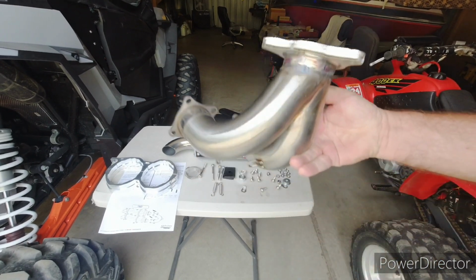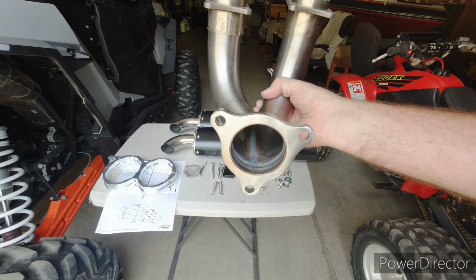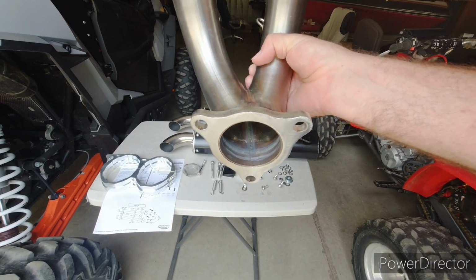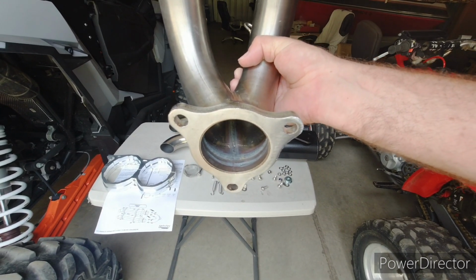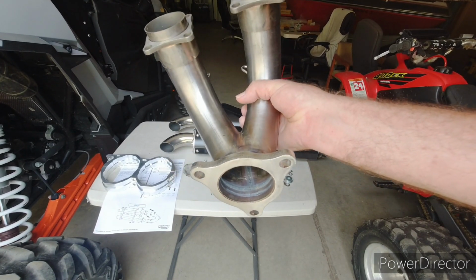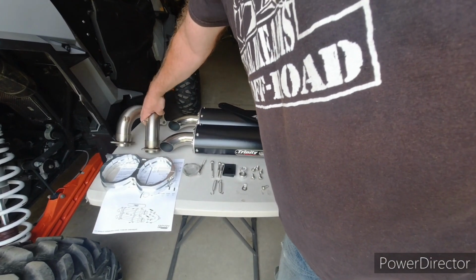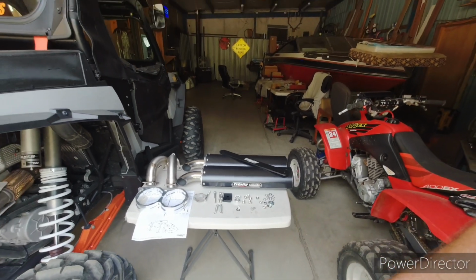And another thing about welding is, if I can get this thing flipped around with one hand, the inside of a pipe, when you do a weld, should look like it was welded from the inside, even though you did the weld on the outside. It's got the nice stack of dimes going across on the inside also. So that's beautiful workmanship. So they do a pretty good job on that. Got a nice TIG weld on the back there also.